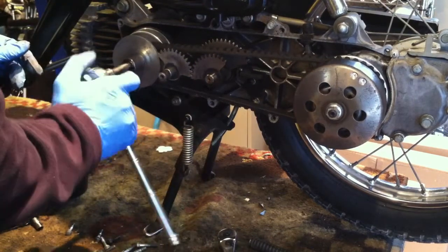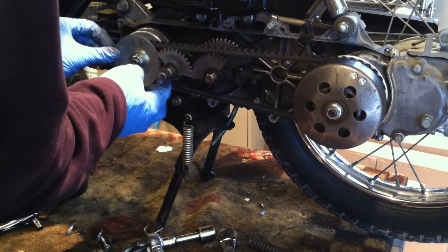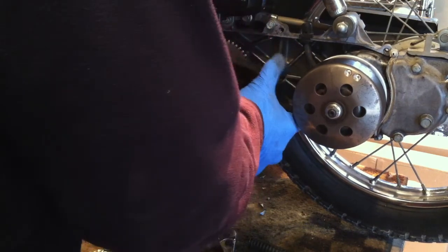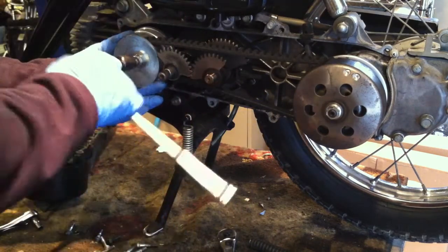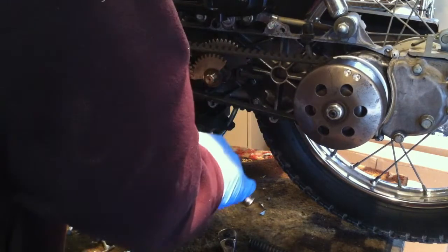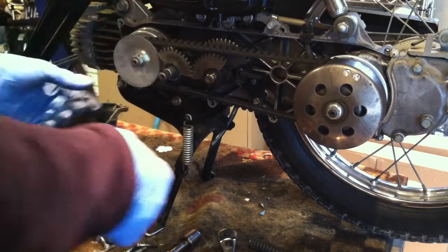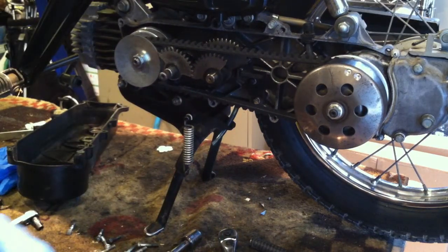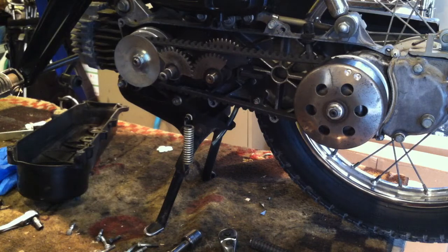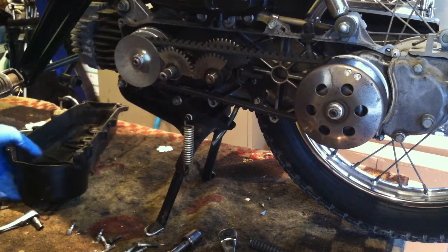The other thing I discovered with this thinner belt is you can get that cheek to center up. It centers up easier than with the BX31 belt. I should pull out the torque wrench and get it to the 22 to 28 foot-pounds or whatever it is. So we dropped down to 36 grams. In my mind I still think go heavier, but we'll try 36 and see what happens.